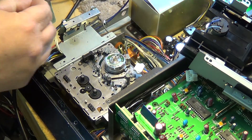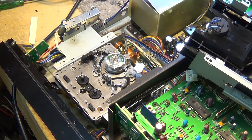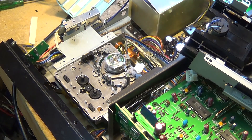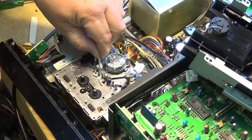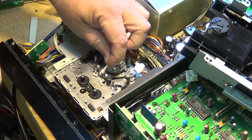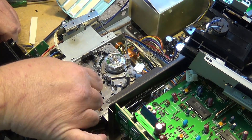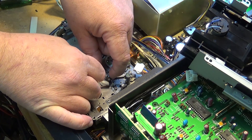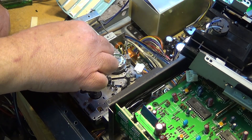I'll do the same for all the guides. For the guides I can actually use a Q-tip or something similar. You don't want to use a Q-tip on the actual heads though, because that's a good way to break them. So we'll wet our cotton swab and clean all of the rollers, the guides, and the pinch roller.